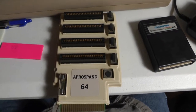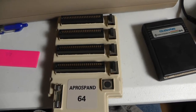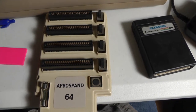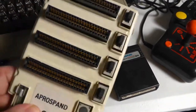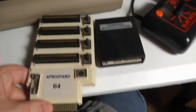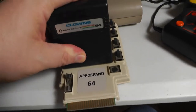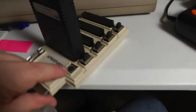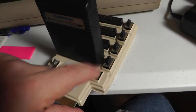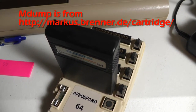Now this video — I'm calling this part two because I showed you how to dump a cartridge with the cartridge cracker. Now I'm going to show you a way I like to do it with just an expansion board. We're going to plug this in the back, and these switches decide which cartridge port you use, along with a reset switch. We're going to load a program you can download called mdump. So let me get this set up.